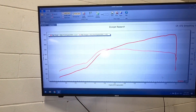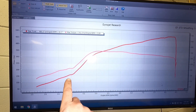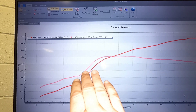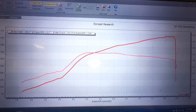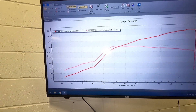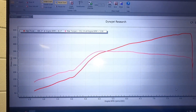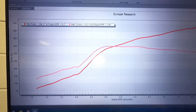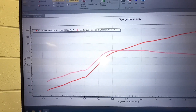I know you guys like to know what I've put into these tunes. VTC-wise, down low is about 30 degrees VTC, quickly ramped up to 40 degrees VTC and then tapered to 25 at redline. VTEC was set at 4000, which helped spool the turbo a bunch. This turbo spooled fairly quickly for a K20 — it had basically full boost by about 4,700 RPM. That's why we see the torque peak where it is.